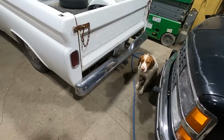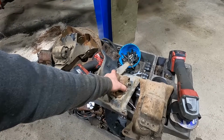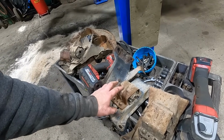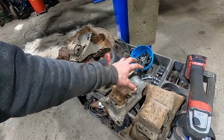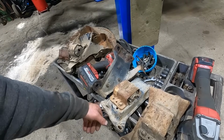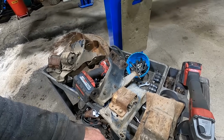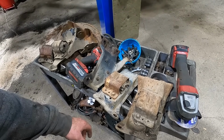You look tired. All right, people are tired of me talking, so I'm going to put these engine stands in. Ideally, if you're doing this right, these are rubber-mounted engine mounts. I've never seen them fail. And if they do fail, they just kind of rattle around in there. They're encapsulated, so if you were doing a full rebuild, you'd get new engine mounts here, but we're not. Wish I had marked which was right and which was left, but we shall figure it out.